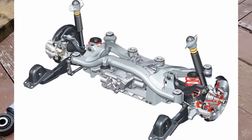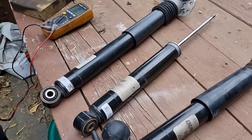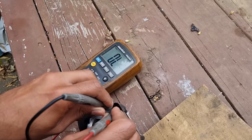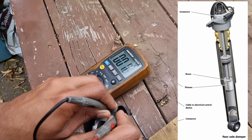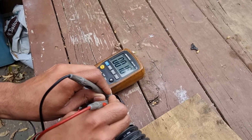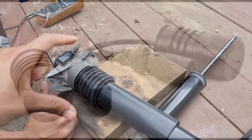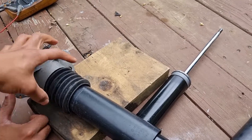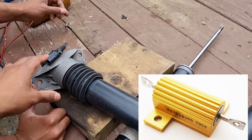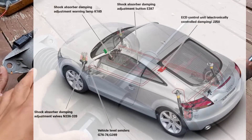Apart from that, this is just a brief summary of what goes wrong with these shocks. There'll be a lot more coming in the near future — more in depth on the shocks when the vehicles are moved, and we will show you the test mode on the sports button as well. Using an auto-range multimeter, touch the two probes to the connectors — generally it's about 1.2 ohms. The coil is about 1.2 ohms, plus or minus about 1 ohm. This is why, when you use a delete kit in replacement of this electrical shock, that delete kit normally is some sort of coil-type resistor. It has to be something of high wattage because 30 amps is what the control module supplies to all four shocks.